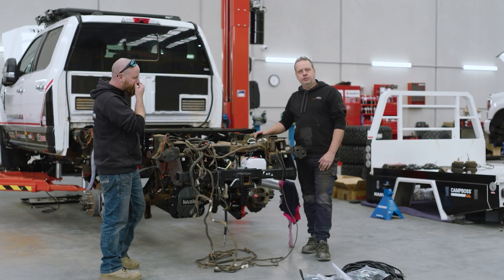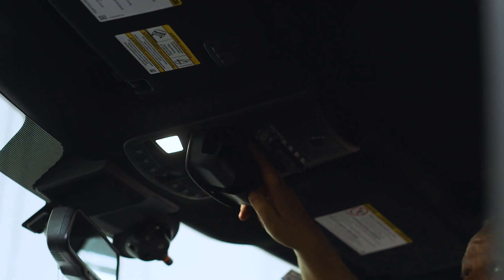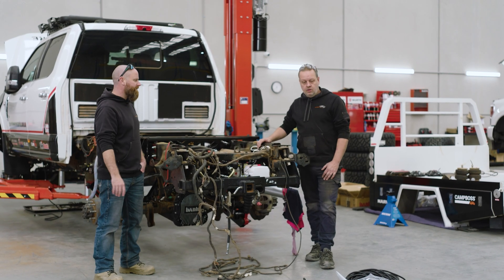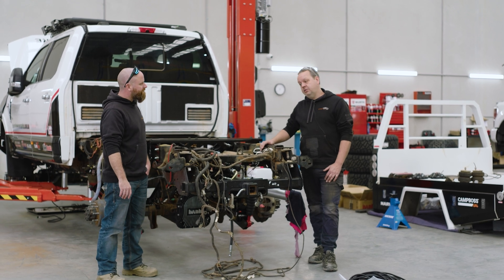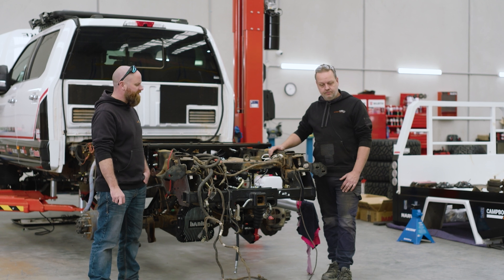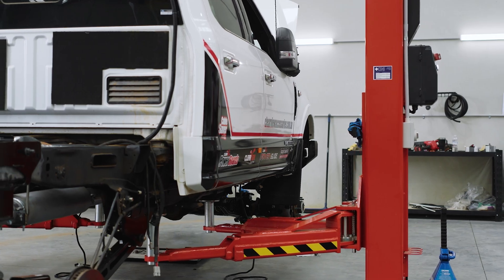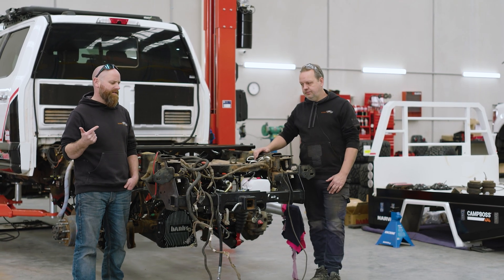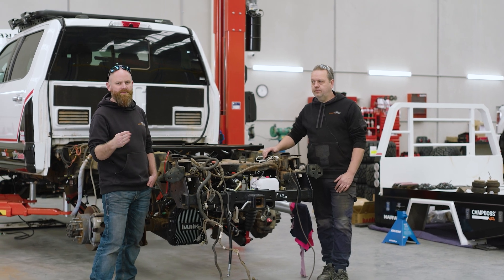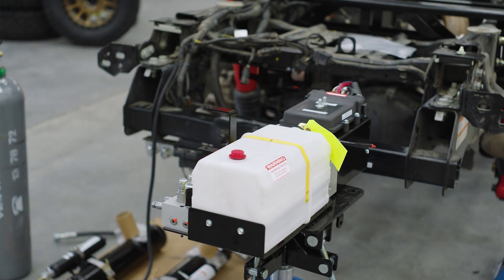Inside the cabin we've got a screen which controls your ride height up and down, so you can control everything from inside the cabin — and Bluetooth too. The harnesses are pre-made and don't need much modification; they actually tap into the OE harness inside the car, so it's pretty easy to install. The system picks up a speed sensor, an ignition tap, brake sensor, and there's also a mechanism on one of the steering arms for a steering angle sensor. There are also inertia modules inside the ECU that give it brake and cornering readings.